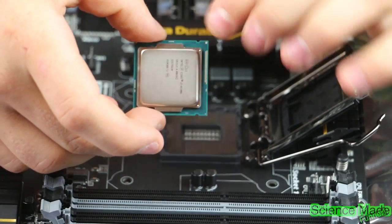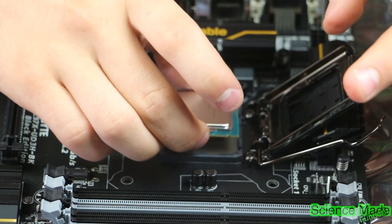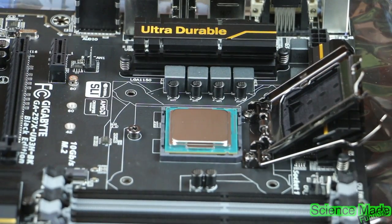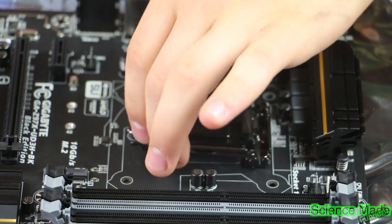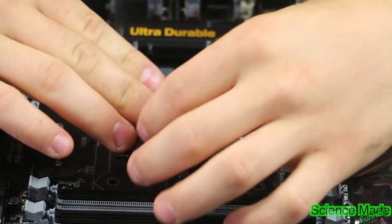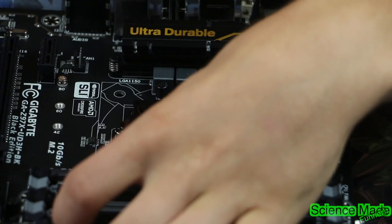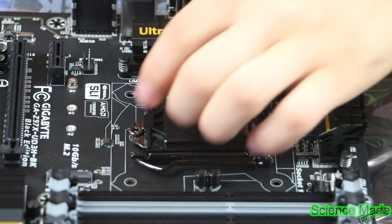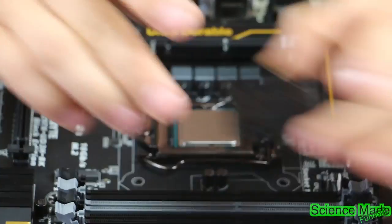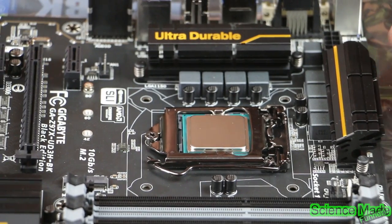There are notches on the CPU — ones here and ones down on the CPU. Make sure those notches are lined up correctly when the CPU goes in. Get the CPU in, making sure this piece is underneath the screw. This lever is fairly hard to put in — it takes a push. Then this cover piece will pop off. That's just a cover. Sometimes the manual says to take it off before you put the CPU in. There's your CPU installed.